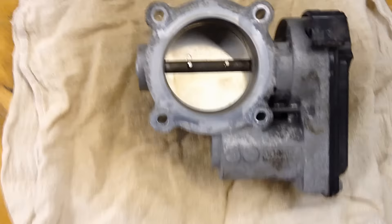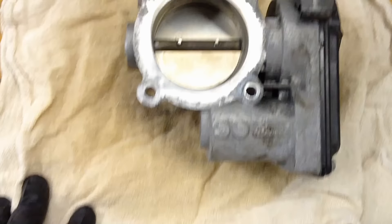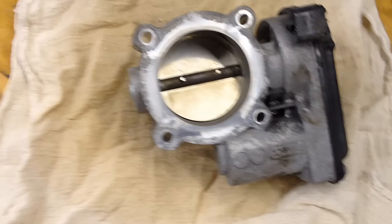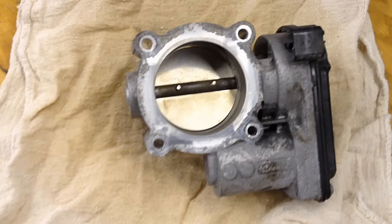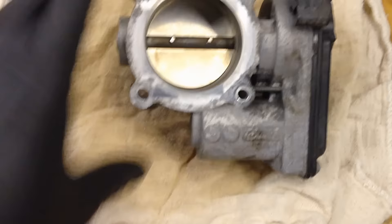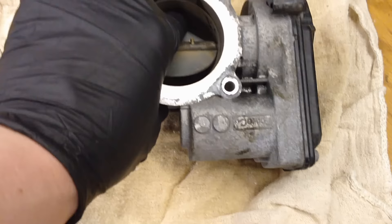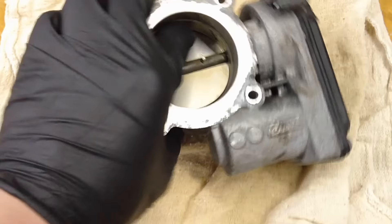The other problem is safety. This motor has a gear reduction set in here, and according to Ford, if you stick your finger in here — even with the key off — some of these throttle bodies do a sweep. They have ice breakage strategies built into them. Either way, it's a high torque motor with a gear reduction gear set, and what they say is that if you're in here cleaning and that thing actuates to close, it can actually chop your finger off.